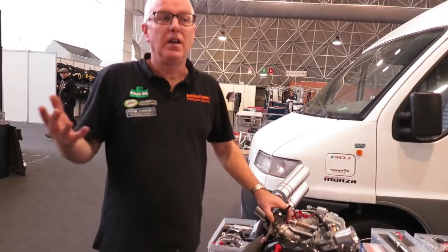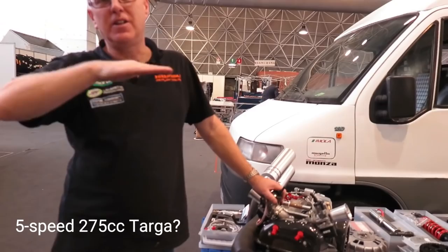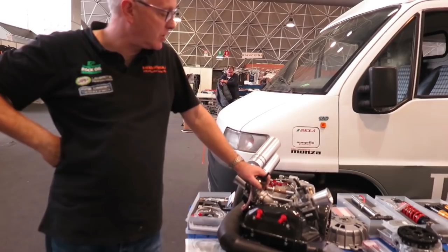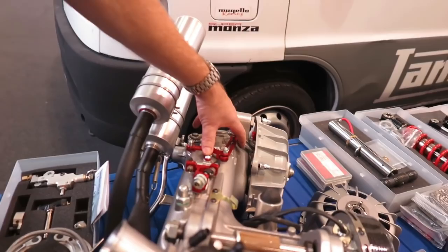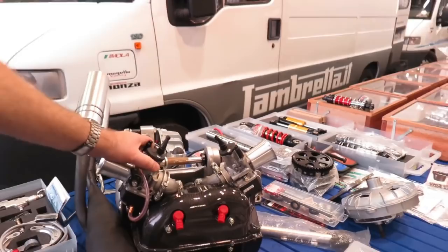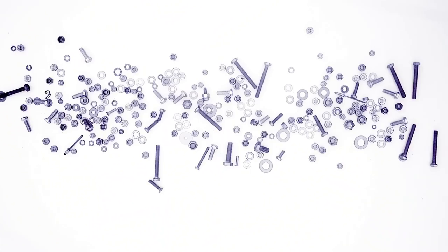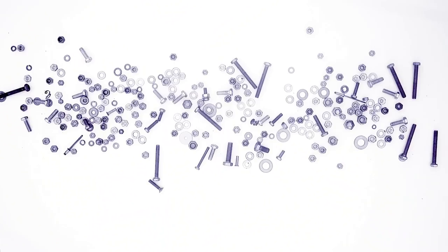The idea with the reed valve is we're hoping to have more linear power and better fuel consumption. The latest one is 275cc now — it's seriously getting quick, and very robust. We're standing at four-speed but we're talking to RaceSpeed about putting their five-speed in as an option. The RaceSpeed five-speed seems to be holding up at 40-odd horsepower. The guys doing the Edwin Berger reed valve conversions with this pipe and five-speed — it's 25 more than we figured, and it's holding up, so it's likely going to be good news.